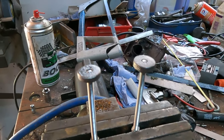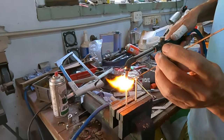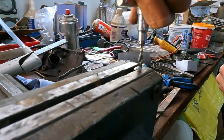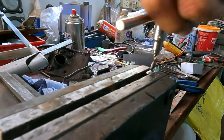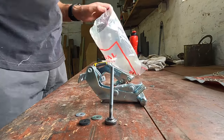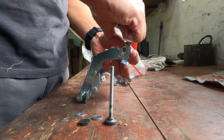We fixed the vent screws by replacing the threaded bar with some new bar and then soldered them into place. A quick test fit of the new screws showed that this was all going to fit nicely and work fine.